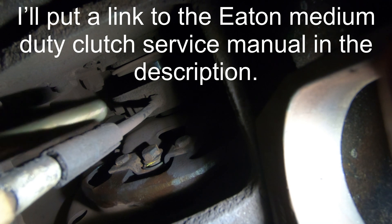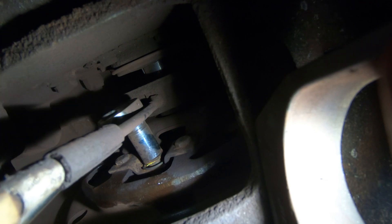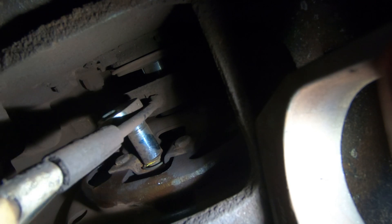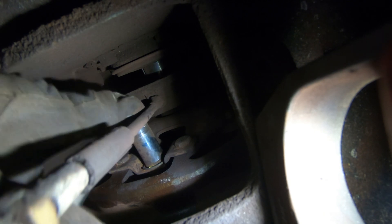You've got to have a half-inch gap between your throwout bearing and your clutch brake — right now it's a little big. To bring the bearing back, turn it clockwise to release. You have to have the clutch pushed in to adjust this.